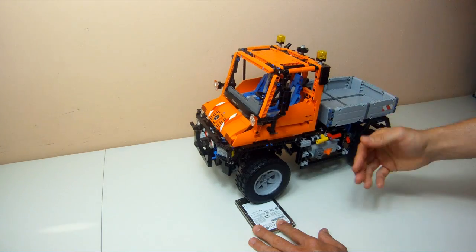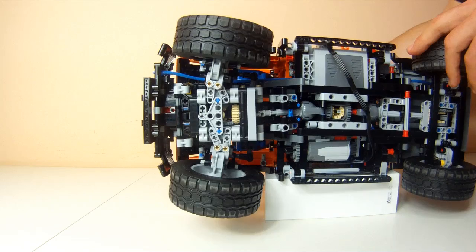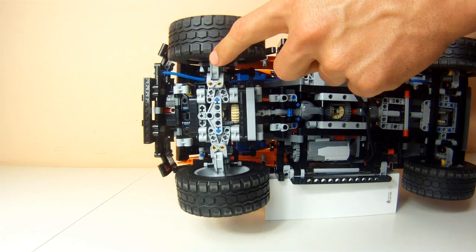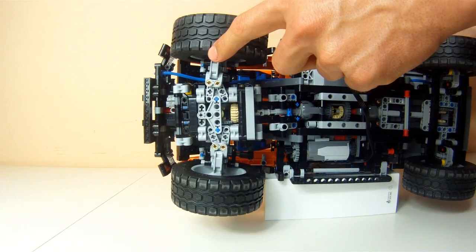When viewed from below, we see the double pivots in action and how they move the actual pivot point to about where the gears are in the wheel hub. Because the steering axis is inclined, the actual pivot of the suspension is of course at the edge of the wheel, about where my finger is.